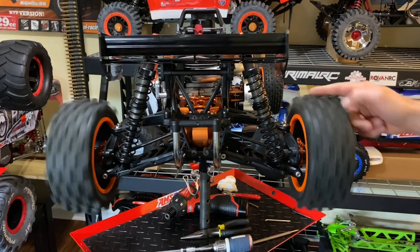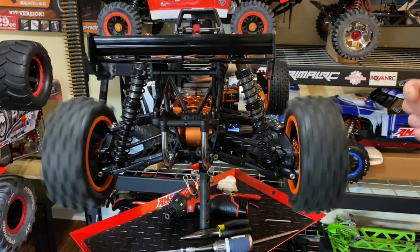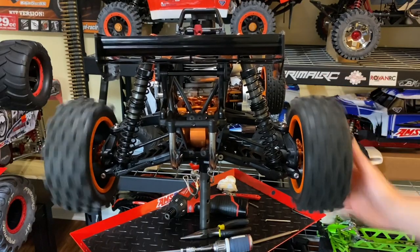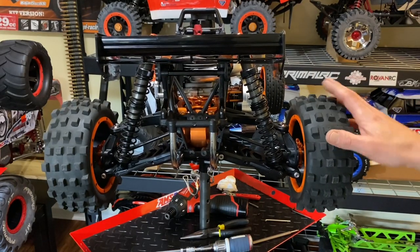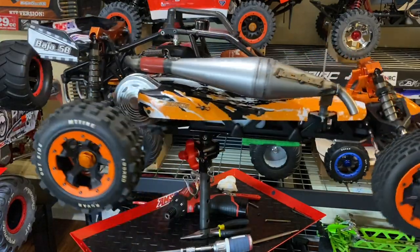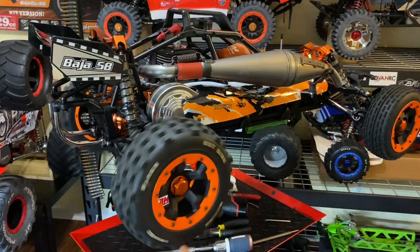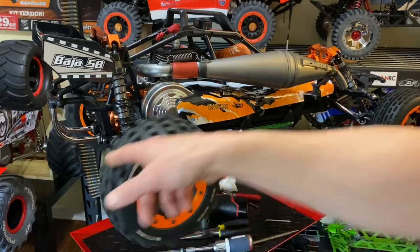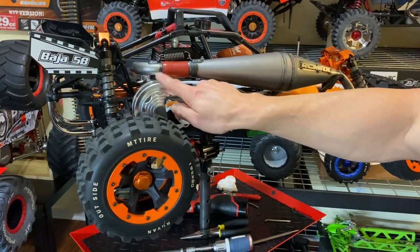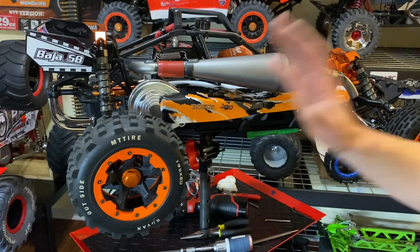Free right up — no binding whatsoever. That's what you want. Look how it looks like one wheel is going the other way when you spin it real fast. But I can assure you that is a true PosiTrack diff I have set up in there for Pops. So that's it, y'all. That's going to conclude this video. As you can see, it's not hard to do the brakes, and when you do it right everything should roll buttery smooth. You don't want any power loss or dragging going on because that also burns the clutch out as well. Couple that with a bad tune and you will smoke your clutch and fry your seals.